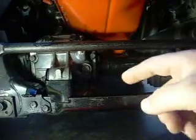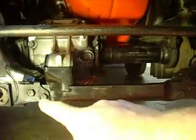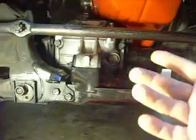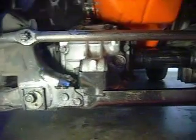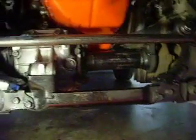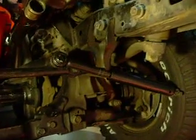On either side, and then remove the crossmember. And I wanted to make sure about these bolts, right, so that it can actually move — obviously it can't go down if I don't remove those. And then it said to move the steering linkage out of the way, unbolt the Pitman arm, etc. I thought the Pitman is the idler, which is new — I think it's a Moog.